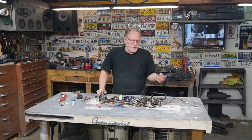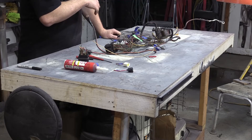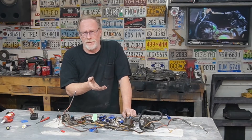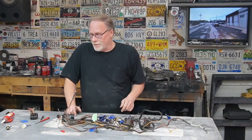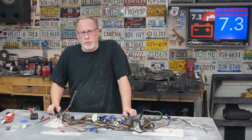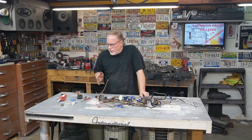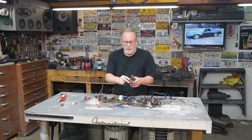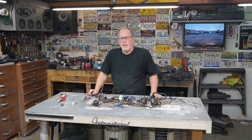Be careful about where pin 18 is located - don't add too much wire. Using the old wire limits you to the correct length, because if you add too much wiring you might run into a situation where the belt is spinning right there and hits it over time, causing a check engine light related to the temperature sensor. Once done, push the back cover back into place and clip it on - you're all set to go.